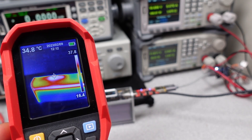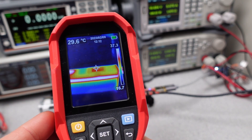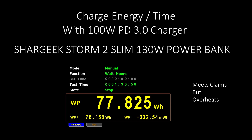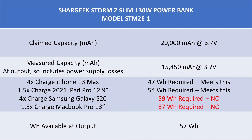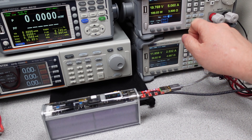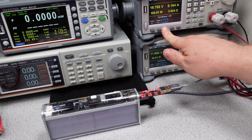The thermals on this power bank during both charging and discharging were unstable and continuously climbed. The unit casing continued to get hotter even after overheating — around 53 degrees C while charging and 60 degrees C while discharging — and the case never got to the internal reported temperatures. For a battery, I would call this hot and warmer than other power banks. The battery cells get too hot and the electronics get too hot anywhere over 40 watts of capacity. This even overheated during the 65 watt charging cycle. I did have one instance where the battery capacity suddenly went to zero and then came back to 100% when I tried the discharging.